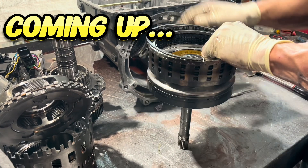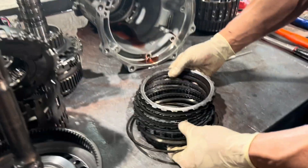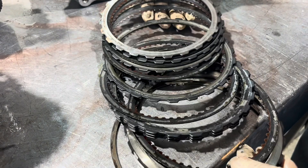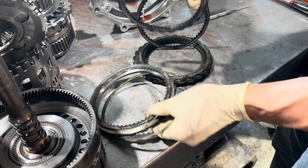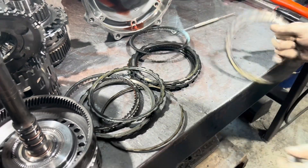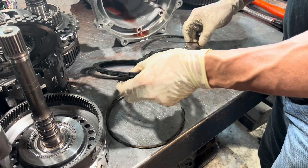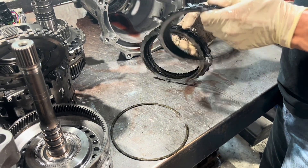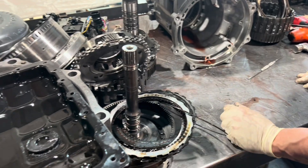These things are burnt in a lot of these JATCO transmissions. Wow! These are F-U-K-T, so to speak. These are like welded together. Yeah, it's like one solid chunk. So when that happens, that clutch doesn't really release. This thing's in pretty friggin' bad shape here.